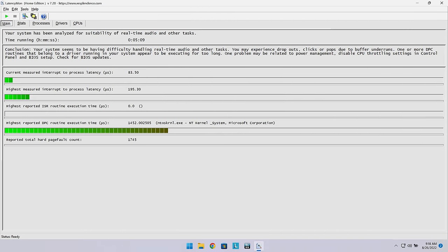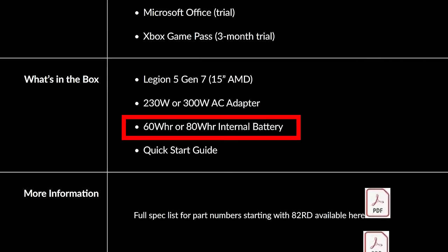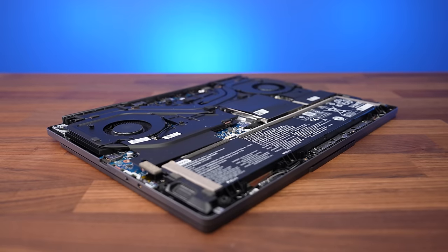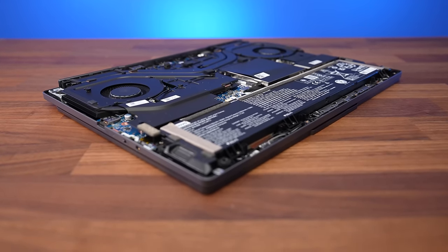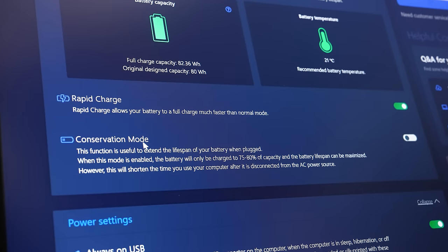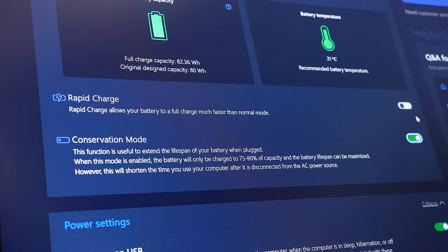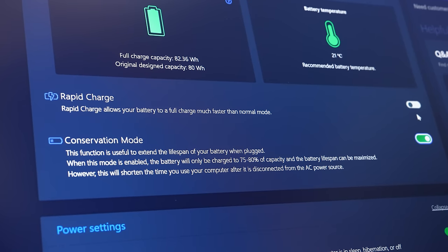The LatencyMon results weren't amazing, but not as bad compared to this year's Legion 7i. My Legion 5 is powered by a 4-cell 80Wh battery, but there's also a smaller 60Wh option, so expect less runtime with that cheaper one. Unlike the higher-tier Legion 5 Pro or Legion 7, the 5 doesn't have the Function+R shortcut to swap the refresh rate down to 60Hz, which is a shame as that can increase battery life. Battery life was quite good despite this — generally the case with AMD-based laptops — though this year's model wasn't quite as good as last year's Legion 5, but it lasted more than 8.5 hours. You still get the option in Vantage to limit the maximum charge level to 75-80%, and rapid charge can also be enabled but not at the same time as the charge limit.